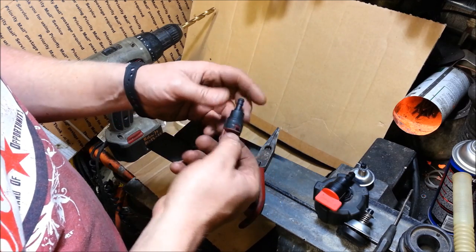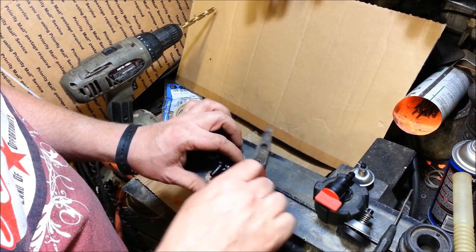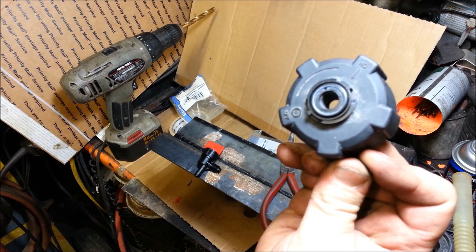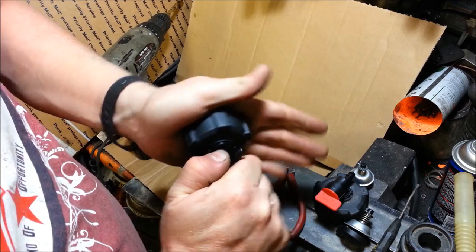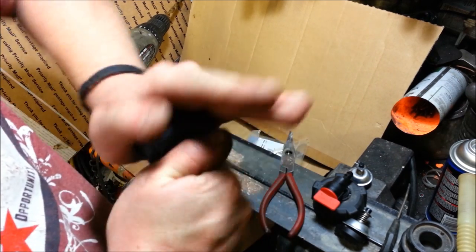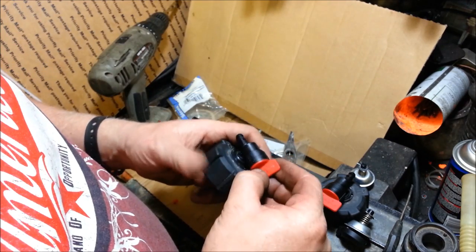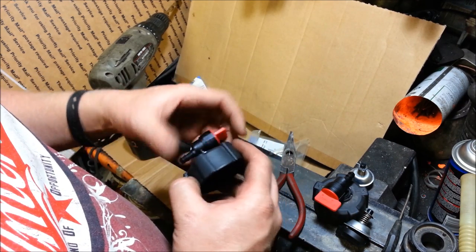The original Briggs & Stratton petcocks have a little O-ring. The aftermarket ones I just bought are identical, except they didn't come with an O-ring, so I had to supply it. The O-ring sits against that little ridge down in there — just that little teeny step. Now it's sealed against there and the whole thing is airtight. It actually functions the exact same way as the original cap — there's an off position which blocks all airflow, so you can just put this right on without a fuel line attached.